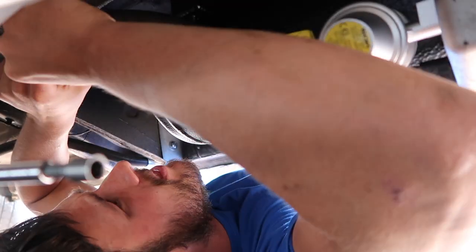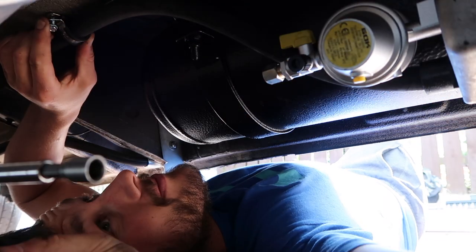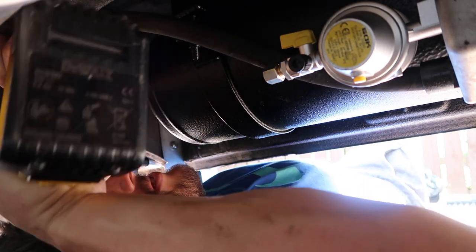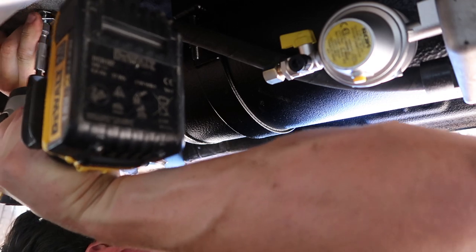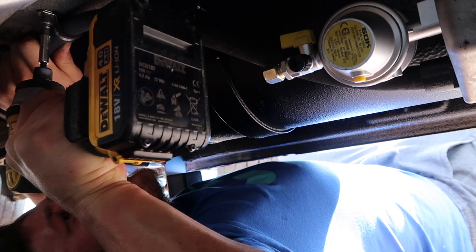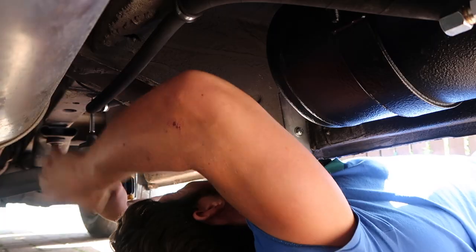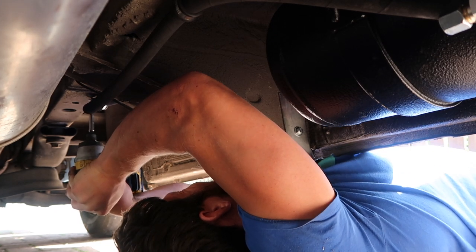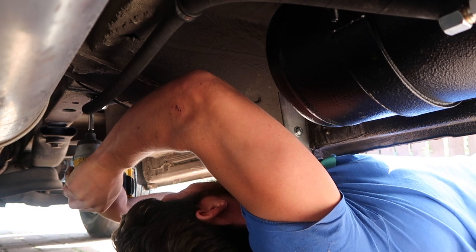As you can see, I've been back down to Autogas 2000 at this point and they've sprayed the tank and the surrounding area with stone chip paint. This will just offer up more protection for the tank — it'll seal the board, stop any rusting, and protect against debris off the roads. They were also good enough to give us a couple of hose clips, which don't actually come with the kit, to neaten up your LPG hose. These are just attached with self-tapping screws.